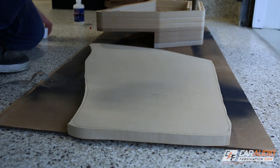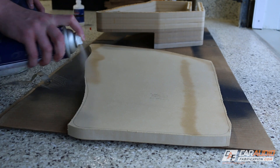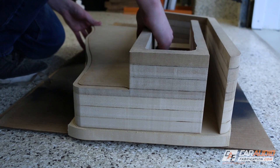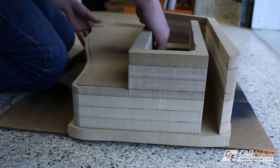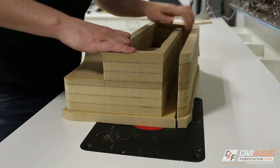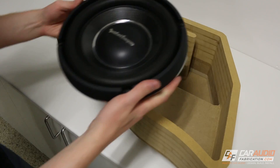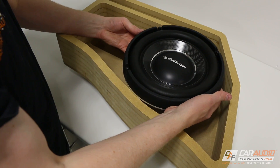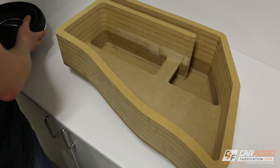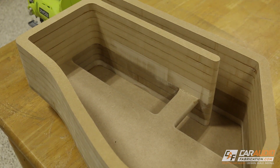For each layer I applied CA glue to the stack itself, then applied the activator to a rough cut piece of wood. I then applied the stack, making sure I had excess material around the full perimeter to shave away and flush trim. I would then copy both the inside and outside profile. I repeated this process until I had the number of layers needed to achieve a wide enough port and enough air volume. It's actually pretty cool to see these layers of materials come together.